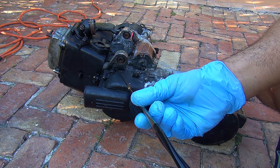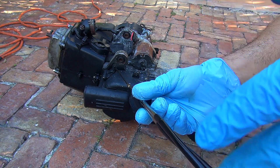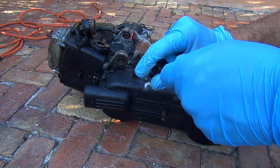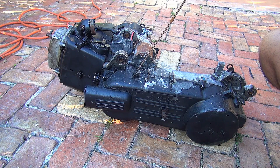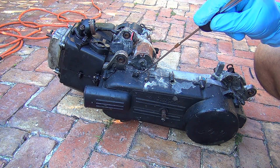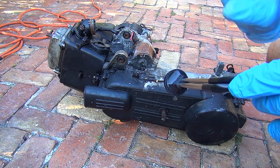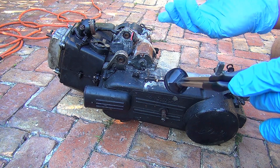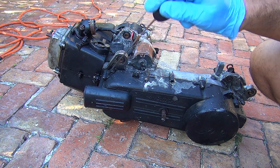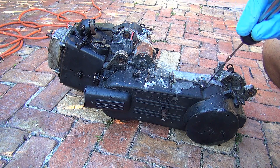Make sure every time you do this your scooter is on idle — never do this when your scooter is running at high speed or high RPM. Always listen to the motor when it is at idle. Now here we have the CVT cover. By pointing the stethoscope on the CVT cover you can listen to the variator — if it's working perfectly or if there's grinding noise. You can also hear if the roller weights are breaking down; sometimes you can hear some crackling when they start to wear out, which means it's time to change them.